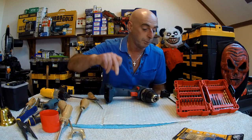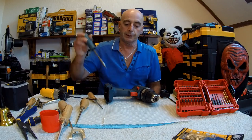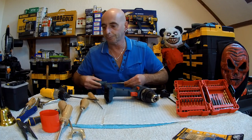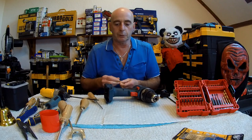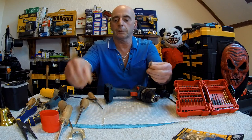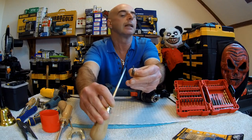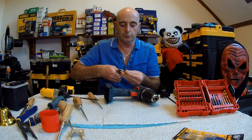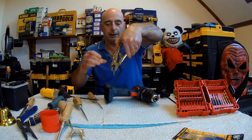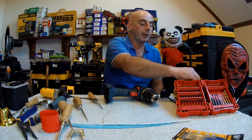There's another way, but you're not going to do it with this one because the screw is buried way down. If you're using 25mm bits, they ain't gonna reach — end of story. You're going to have to get a long bit for this one. You can't even try filing it down or using pliers to push it in from inside — it just won't work. You need a long bit.